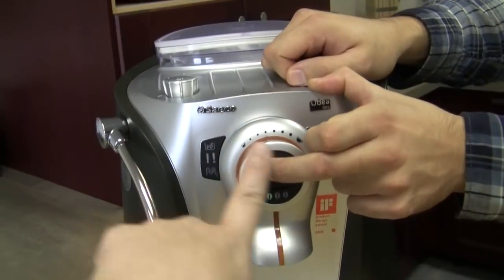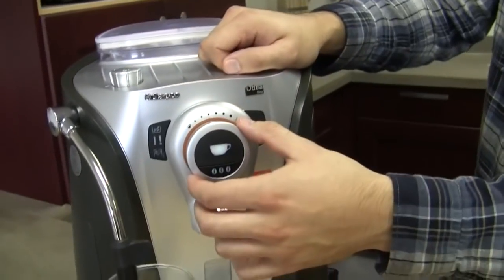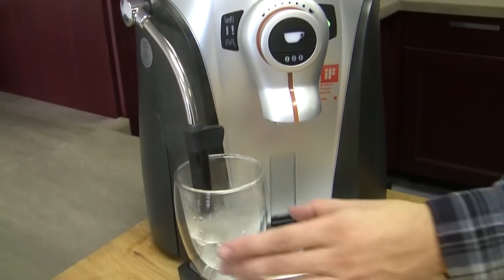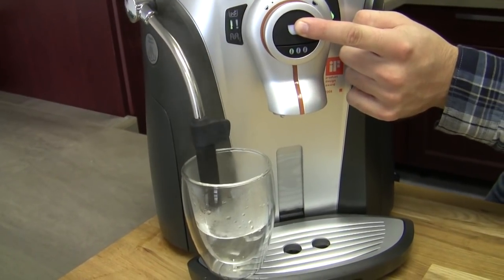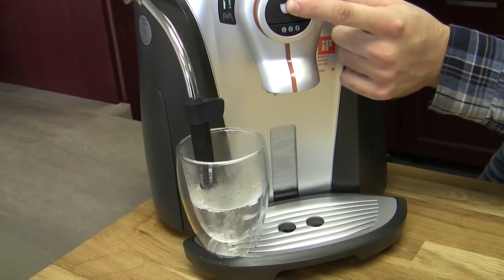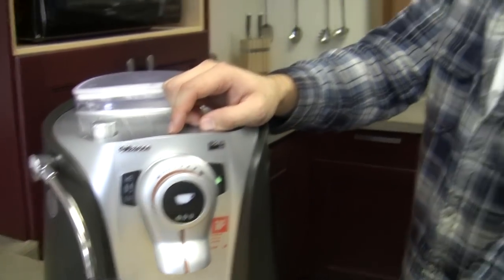So when I'm at 12 o'clock and I press the button on the right, that's dealing with my brew group. And at 12 o'clock with the coffee button I'm dealing with my heating element. Just for fun let's do it — I'm going to go back to the pump, because I was just holding down the heating element that whole time. And as you can see it's quite hot — so we know that's working. It's not going to be at full temp because it takes longer to heat up fully. So to test this if your coffee is too cold, you could measure the water temperature, do that, measure it again, make sure that it's actually cooking up. You probably want to hold that down for a good minute actually, just so the heating element is on long enough to heat the water.